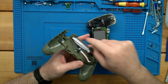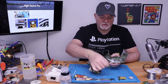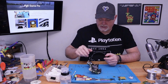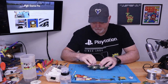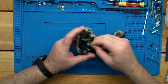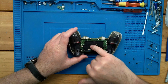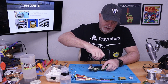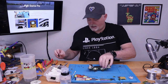If you had a charging problem, we'd take this apart and get this board out. I change those out once in a while — that's a broken one from the other day. We'll go ahead and get our battery out; it's just a little double-sided tape holding it in and you can unplug it. Then there's one screw here that holds the board and all the guts into the top half.